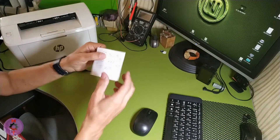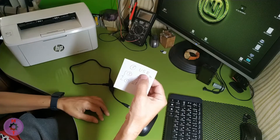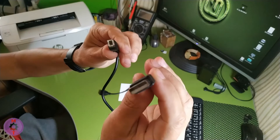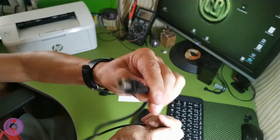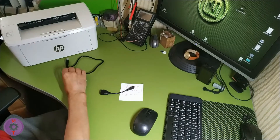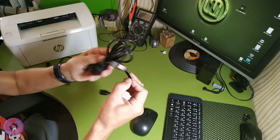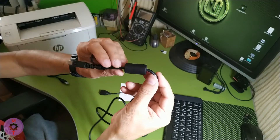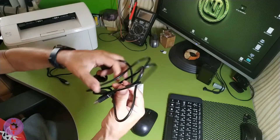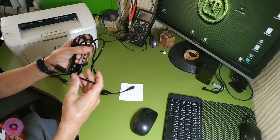So what ports do we have? The first and cheapest, basic one is USB. This requires a cable of this type — connection type A on the computer side and type B on the printer side. Please use the correct cable: mandatory USB 2.0 and be sure it has ferrite filters, preferably on both sides. The length of the USB cable will ensure hassle-free printing up to 2 to 3 meters, rarely 5 meters, but a long cable is undesirable.